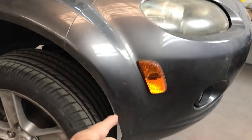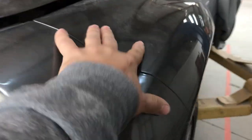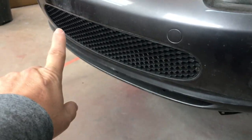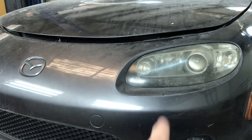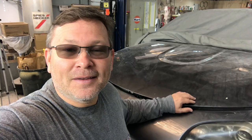There are clips in the splash shield, bolts all the way across the top here that hold the bumper to the core support, more bolts behind here, and bolts and clips across the bottom. So once we get all those off, we'll be able to pull the bumper cover off and then take the headlights out and put the new headlights in. It's a pretty easy conversion to make this car look like a 2015 — you don't even have to change the hood and the fenders because they're the same.